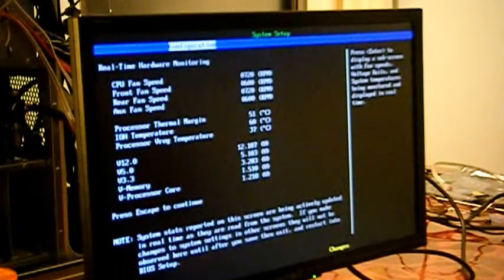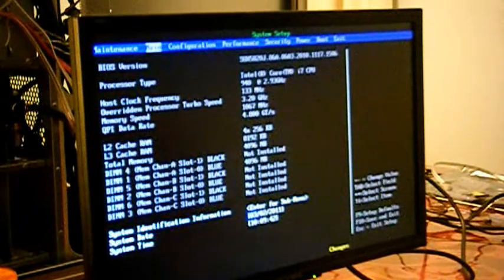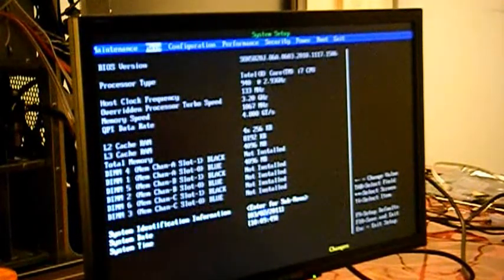Temperature is to check if you properly installed the fans and the thermal paste. Average temperatures for i7s are around 40 to 50 C. Dual cores are around 38 to 45 C. If the temperatures are in the 80 and 90 range, please double check the heat sinks and fans for proper airflow. RAM timings are the row of numbers listed on the box and the RAM itself. These control the read, write, and speed information. Normally they are detected fine, but some motherboards tend to screw them up, so check the settings.